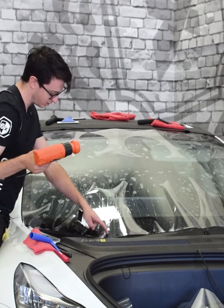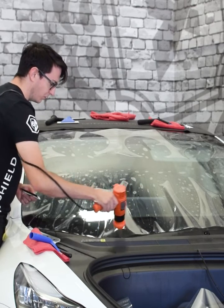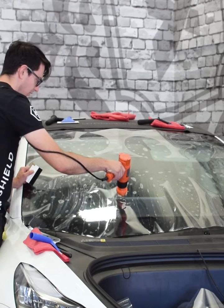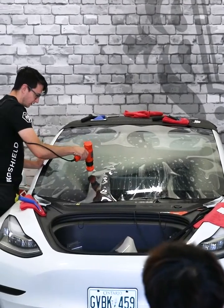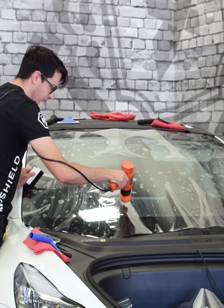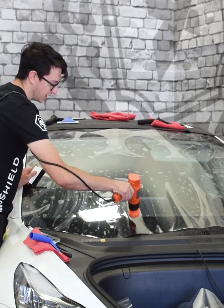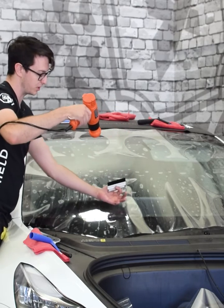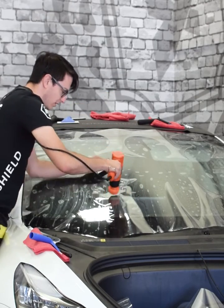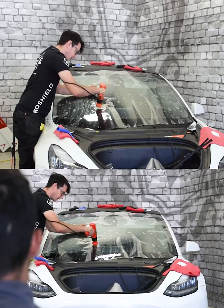There's going to be some dimples that occur in the sides and corners of the film — that's a good indicator that we're getting to the point where we move to the next step of shrinking, which is to move the heat gun slowly up one side of the finger, over and down the other side, really allowing the film to react. Then we're going to do big circles or ovals with the heat gun nice and close so that we don't have any heat falling off. If we hold the heat gun out here, there's barely any heat being applied to the window — that's like hairdryer temperature.